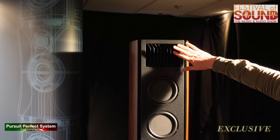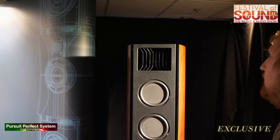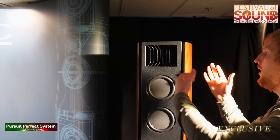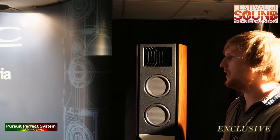Up top, we've got the Lamin Air vent, which we first featured on the 25 series. It's basically aerodynamically smoothing the flow of air going in and out of the cabinet. As the drivers move in and out and pressurize the transmission line, a lot of air moves. If you put your hand in it when it's working loud, an awful lot of air gets forced in and out. The Lamin Air vent just smooths the flow of air — it makes a lot less chuffing noise, a lot less distortion in the bass, and gives you a clearer and more well-defined bass.